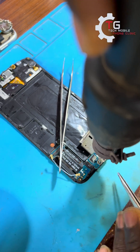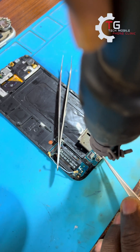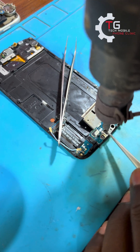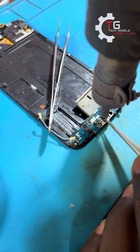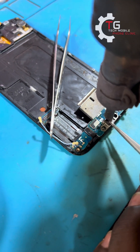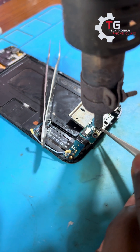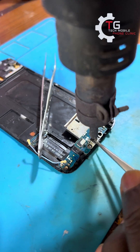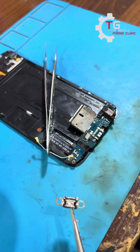You can see my nozzle is facing the charging port itself and not any other area. My temperature is around 400 to 500 degrees — you can set yours to 400 or 500 degrees. We don't want to waste much time on the charging port, so immediately it gets weakened, you remove it swiftly. You don't need to dwell on the charging port for too long because the temperature can melt the home button underneath.